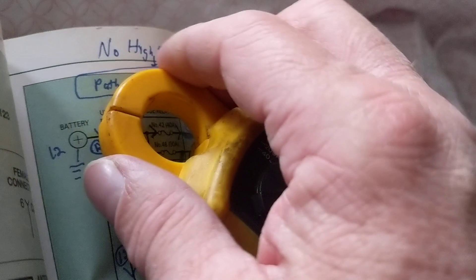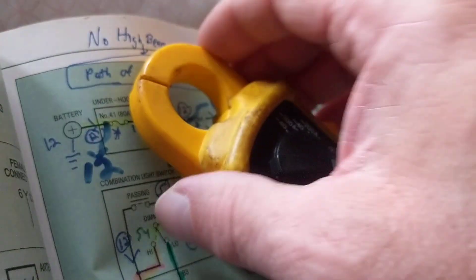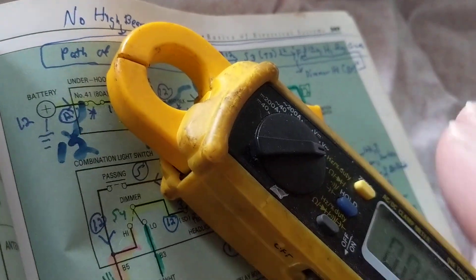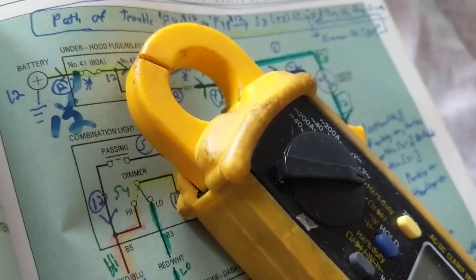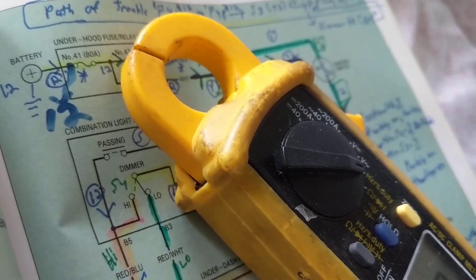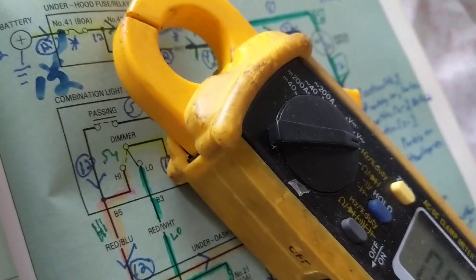Pay attention to the jaws of the clamp meter. Make sure they're small enough — electricians sometimes use larger clamp meters for AC three-phase wiring where the jaws are much bigger. That's fine for electrical work, but for cars where everything is cramped and narrow, you need the smallest jaws that can still fit around the wire. Please see my videos on how to measure alternator current on the channel Joe Electronic Schematics for Auto. Thank you to the subscribers, hope you're enjoying the holidays, bye.